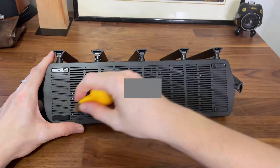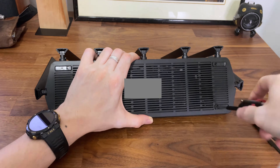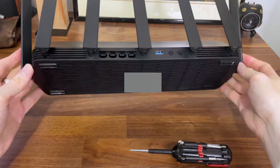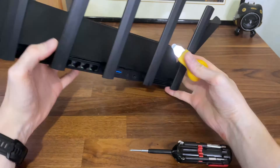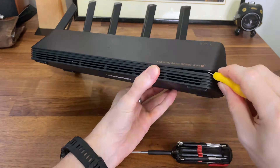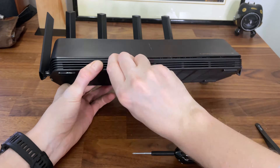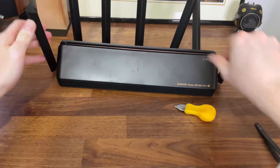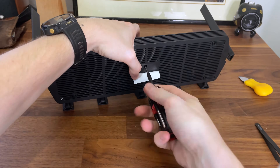To open it up, it's necessary to remove the four screws hidden underneath the silicone pads. As a small spoiler, be aware that there is an extra screw underneath the label — I figured that out a bit later. Also note that there are no warranty seals. After removing the four screws, I used a prying tool to move around the case and it did detach, but the top part would not pop out easily, which is always a sign of an extra screw. And as mentioned, there was indeed one underneath the label.